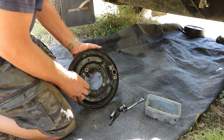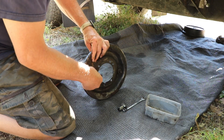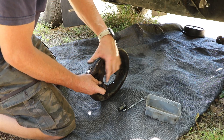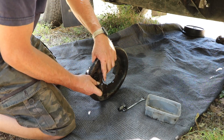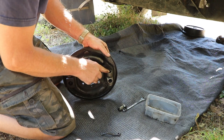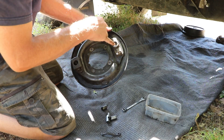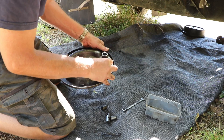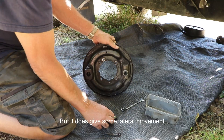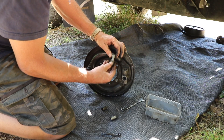In here we have the piston. The piston is connected — I can put it together here. I've turned it around; it's actually facing forward in the car. This is connected to your handbrake lever by a cable, because this is an older version. As you pull it, it obviously moves the piston, and why that's important is because in here we have two upper and lower pistons that are also connected — well, not really connected, there's nothing in here, which is rather bizarre. This whole thing is held on with a couple of clips, basically a clip and a clip together, which means it won't move. Our piston has a bevel — you can see how it's tapered.